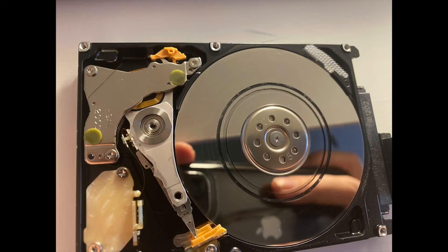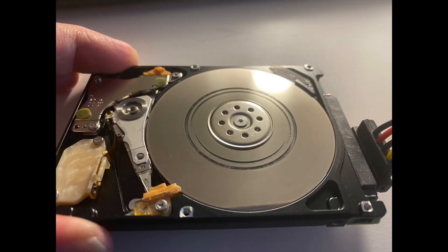Those sounds, I'm pretty sure, are caused by the read head moving back and forth, looking to see if it can find the track that it's trying to read. From the damage shown in the picture, it was still trying but having some serious problems. I suspect in this recording the hard drive was already getting quite damaged, and there wasn't much left before it realized it couldn't continue. Very shortly after it tried to read the first track off of the hard drive, it said I give up, and it stopped making sounds. And so that's when I stopped the recording.